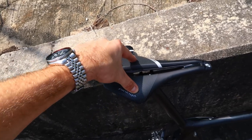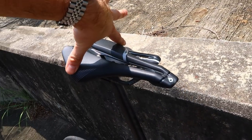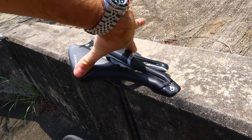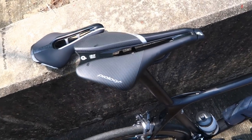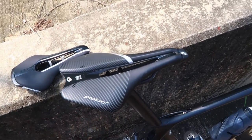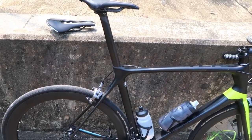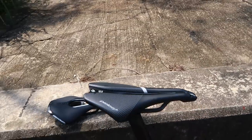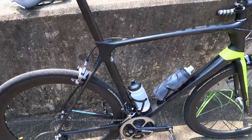If you're sitting bolt upright you would feel it and it'd feel really strange, but most of us sit on the saddle with the V of our sit bones resting on it. It's a really complex thing to get right because everyone's different - everyone's bike is different, everyone's setback on the seat post is really different. That's a huge factor with these performance saddles - it's not just about the saddle itself, it's about the horizontal distance between the seat and the bottom bracket, because that affects hip angle.